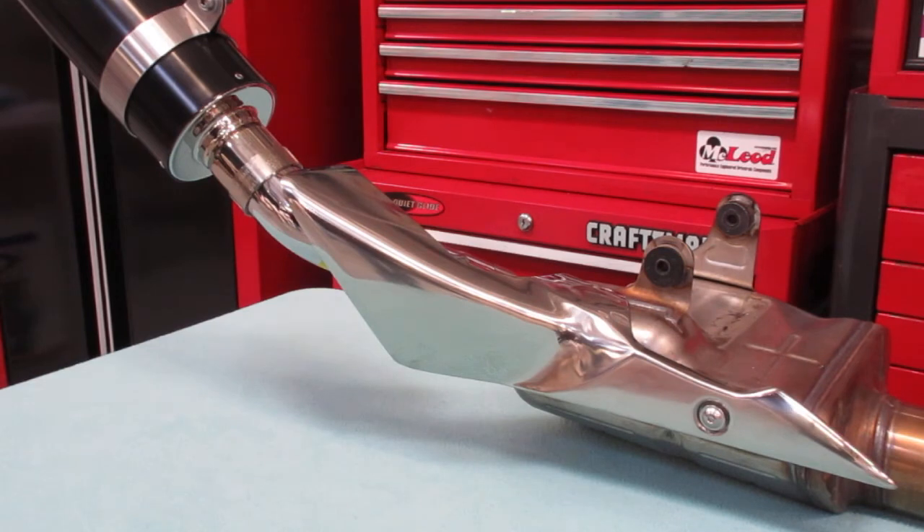If you go with the arrow header, you just remove it. Polish up the pipe — if you get a little mark on it you can put it on a buffer. You could even use a little bit of insulator underneath the clamp, like they use on car headers, if you wanted to. But it isn't really necessary — it'd be up to you. Anyway, there's the install of the shield with the Wholeshot slip-on.